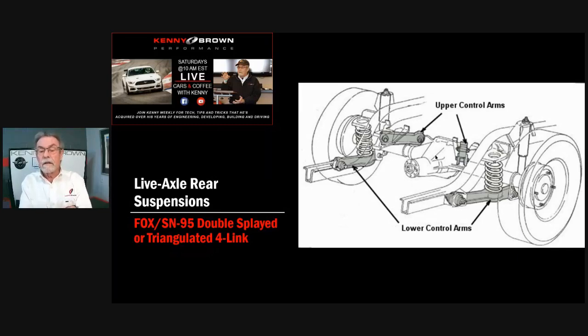So packaging that in there around the exhaust systems was a problem, because everybody had a different exhaust system and everybody expected our parts to fit their exhaust system. I think we had four different, we used to call them Track Kit Plus, four different pattern setups based on different exhaust systems. And even though we'd engineer it so there's plenty of clearance around the exhaust, we still had people complain. And what they didn't realize is they either had the exhaust mounted wrong or they didn't allow enough room, because the exhaust will expand.